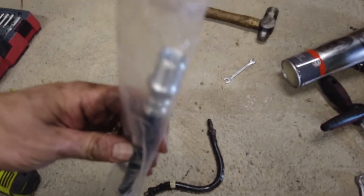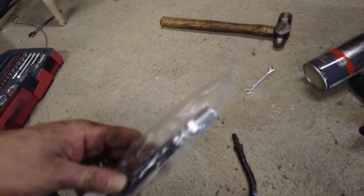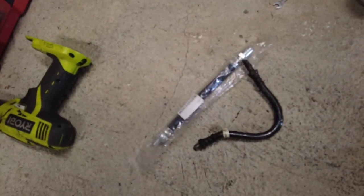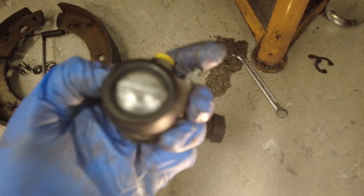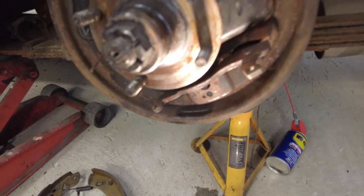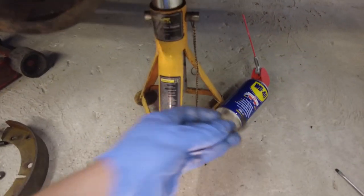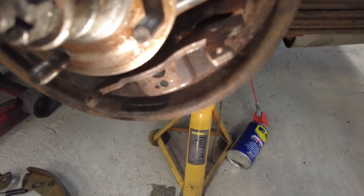That tears the arse out of that - the brake hose I got is different. That end is completely different - it's internally and externally threaded, so the external thread takes the lock nut and the internal thread takes a male fitting, but the car has a female fitting. That's a pain now. Well, if I'm going to be buying new brake hoses I'm going to get a new pair of slave cylinders for the back as well. If a job is worth doing it's worth doing properly. The only thing you need to be careful of is not twisting the brake line when taking it off the back - use penetrating oil and take your time.